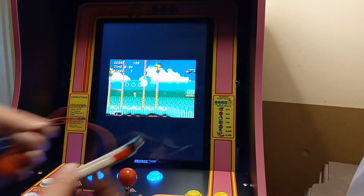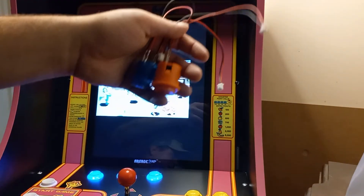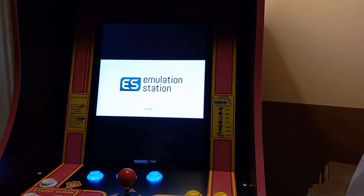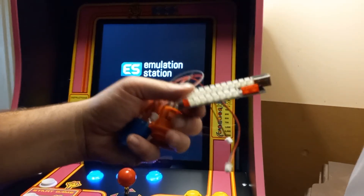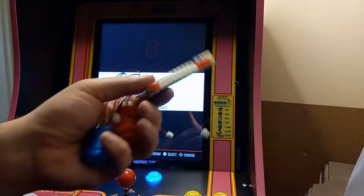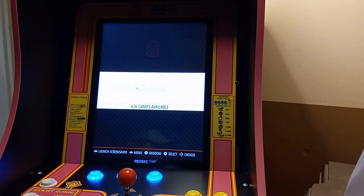I'll show you — I use W buttons as dummy buttons when doing button mapping. I do Start and Select on one, then the A button as well. You don't have to worry about B, X, or Y — just set those to 'not defined.' You have to do this so the machine recognizes two joysticks. When you're in the Pac-Man game and do two-player, everything reverts back to the player one joystick, so you only need one physical joystick to play. But when mapping, you need dummy buttons and a second encoder. Once it's mapped, unplug the dummy buttons and the second joystick.